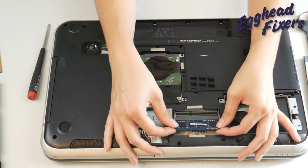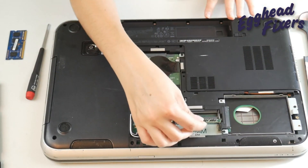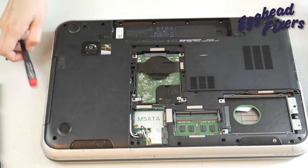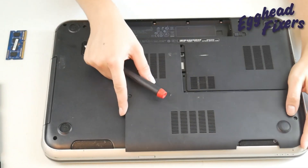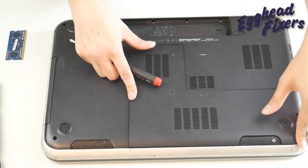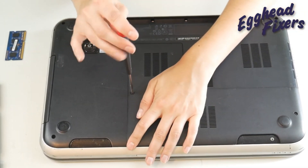I'm going to take out that other stick of RAM and install the one that was not in use, then repeat the process and close it back up. Once again, if it works with that one stick of RAM uninstalled, then I know that that RAM stick is giving me the issue.